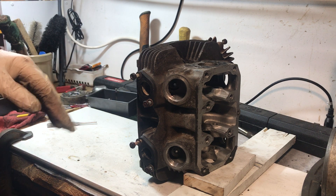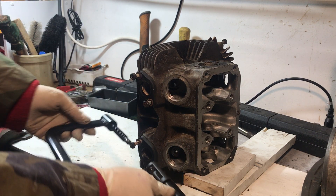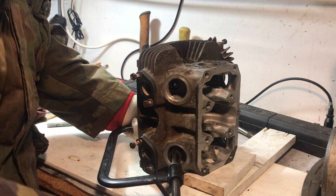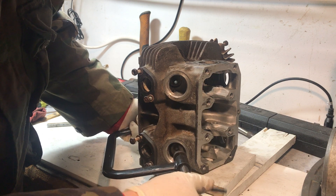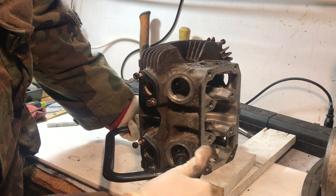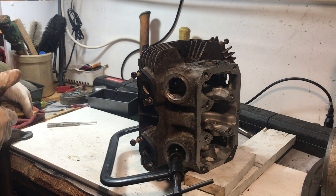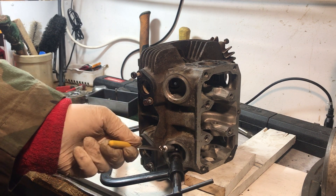We take the keepers off and then the valve spring can be removed from the assembly, and then the valves can be removed. We're going to do one right now — this is the intake valve on the right side of the head. You adjust the tool so the bottom stand is centered in the middle of the valve, then screw it down centered on top of the valve spring retainer plate, which has little keepers in place — they're like little clamshells. You retrieve those using a small magnet, pulling them out.